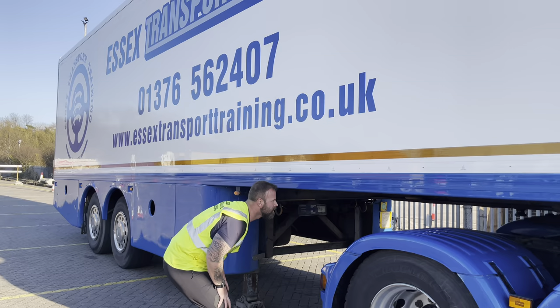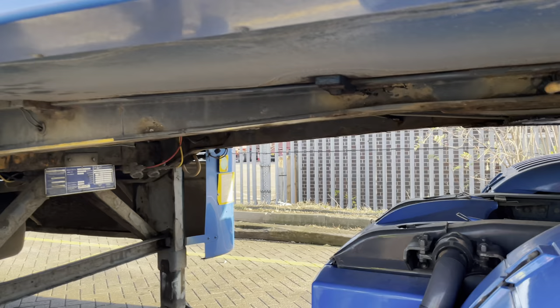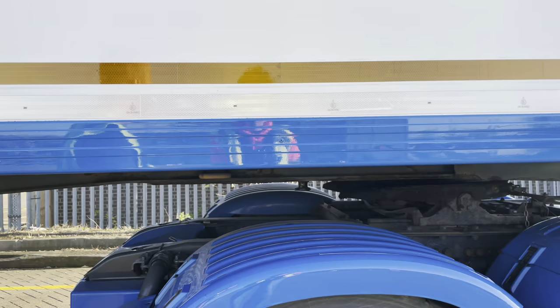At this point it's imperative that my alignment for the fifth wheel and the kingpin is good — and it is going to go in. I'm content that that's quite good and you'll see it in a minute. I'm going to get my wanderlead and put the fifth wheel up to couple her.